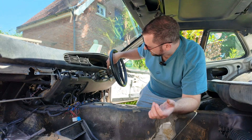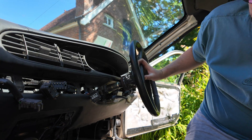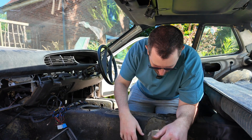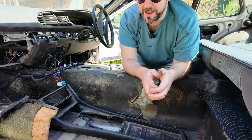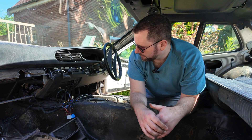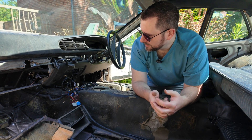There's a weird grating behind the steering wheel - apparently it's like a crumple zone from back in the day, so it could crush into something. I'm not sure that would cut the mustard with safety these days. Most of the interior is out and we want to take it all out, get it back to the metal. The inner sills are an area that goes on 944s, and when they do go you're in for major expense - £10,000 maybe. But they are good on this car, so we do have a solid foundation to build upon. Having now sat in a different 944 with an interior, I feel like the seat could do with going back a bit, especially if you can make for a slightly deeper, more modern dashboard.